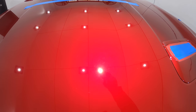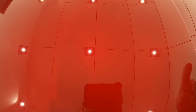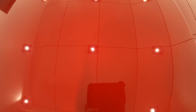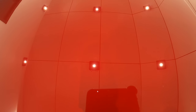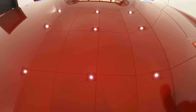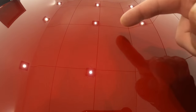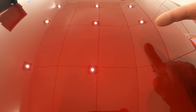So what does this mean moving forward, which is always the most important question you should ask yourself after a test section? It means that if I want a better outcome, closer to 100% defect removal, and perhaps even better gloss levels, I'm going to need a slightly more aggressive approach. Additionally, it also suggests that this isn't an overly soft paint, as if it was, then those minor defects should have really been removed. But beyond that, I'll need to do some more testing to discover more.